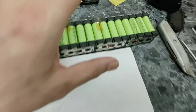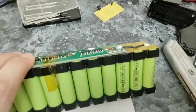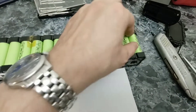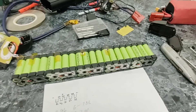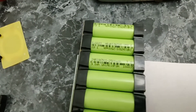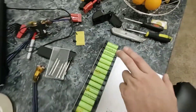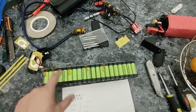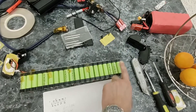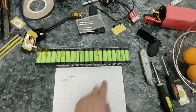I'm going to replace this last group, which is kind of lucky — I believe I might be able to get these batteries out just from the top here without taking the whole pack apart. I might be able to wiggle these batteries out and redo the spot welds to replace just these cells. I have a bunch of these cells left from the last scooter I rebuilt. In case you need to order some, here are the numbers — you should be able to type this number into Google and get the exact same cells. Preferably, if you're replacing just part of them, you'd want to find identical cells. I have about 20 of these cells left, so I'm going to replace these four and the pack should be back to normal.